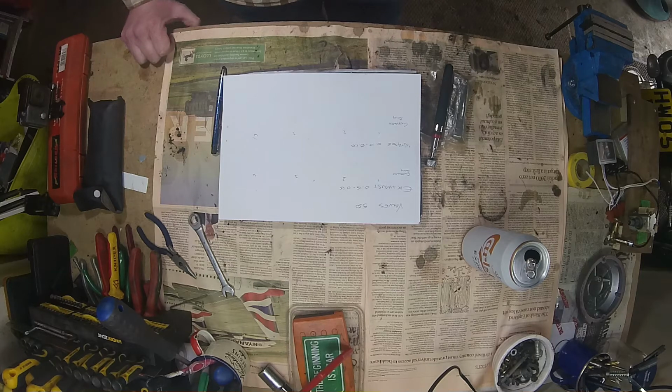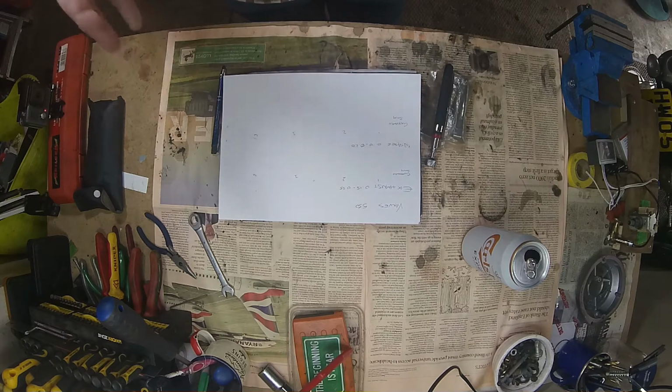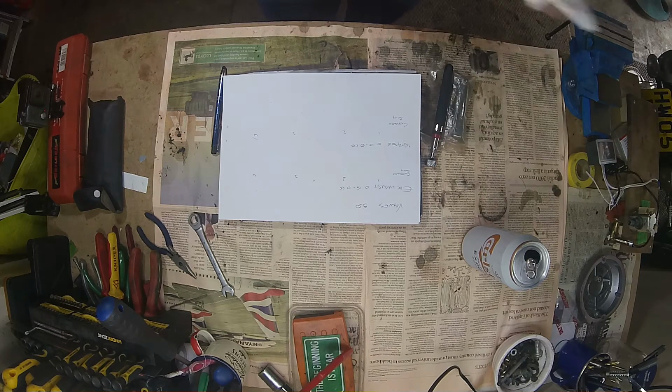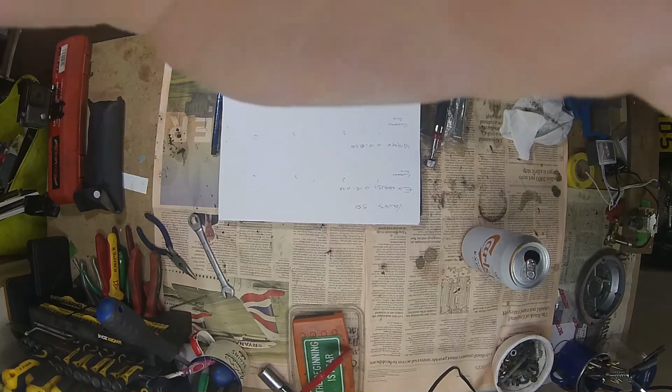Sometimes, depending on the angle of the engine and the access you've got around the frame, it might be carbs or throttle bodies off. Might be the airbox off. Usually something like you have to get a bit of electrics out of the way. So for me, I had to get all the coils out of the way to get access. But yeah, it'll be obvious what you can get yourself to this point through your manual. And from there, I'll show you the rest. So yeah, let's go and get on the bike.